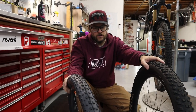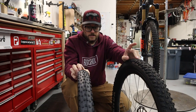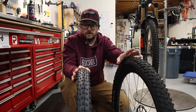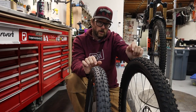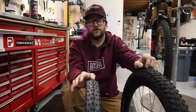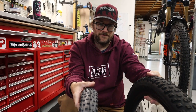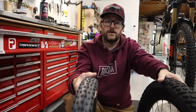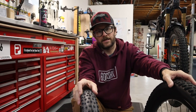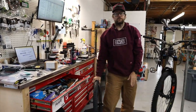The other big benefit of going to a mullet setup is your rear wheel is lighter. Two really big benefits from a lighter wheel: one is it's easier to spin up to speed, so accelerating out of a corner you have less weight to spin up. The other thing is unsprung weight - anything basically below your shock or fork. Unsprung weight in the rear end is whatever isn't sitting above the rear shock. A heavier thing hitting a bump takes more effort to push that wheel out of the way and over an obstacle, whereas a lighter wheel reacts faster so your suspension will be more supple. It's a big thing in auto racing - they go for unsprung weight reduction anytime they can: lighter wheels, lighter tires, lighter brakes. Unsprung weight is very important.